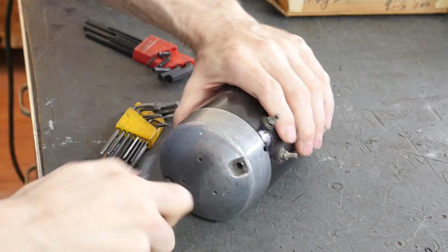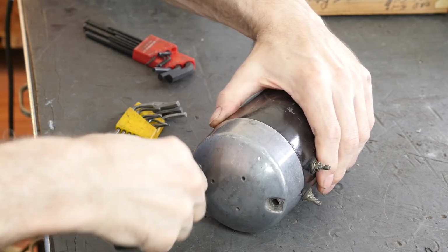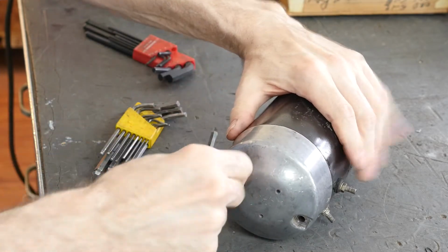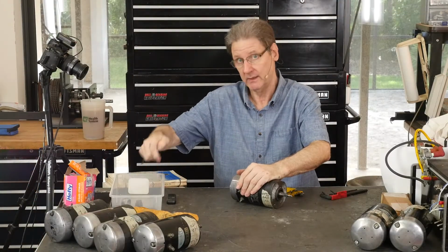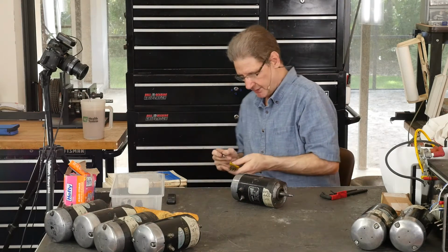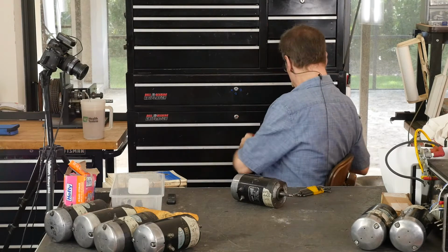I'll go in the parts washer. This one, equally loose. Let's make sure I'm doing the right one. Stiff, no motoring. No motor means when we put voltage to it, it barely would turn. That's that armature. Now the brushes might be bad, right? It's conceivable when we get into this. The armature will be good, and the brushes is what will be bad. So metric cap heads.